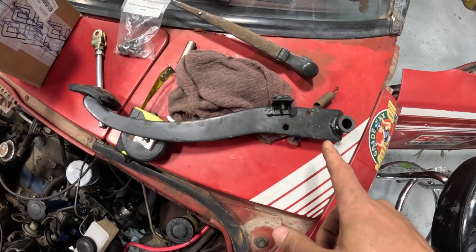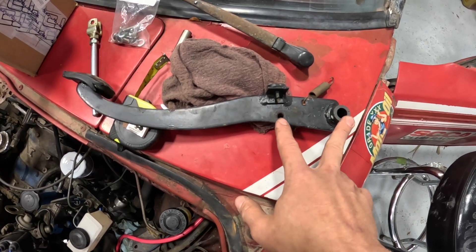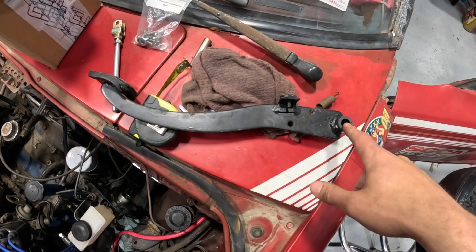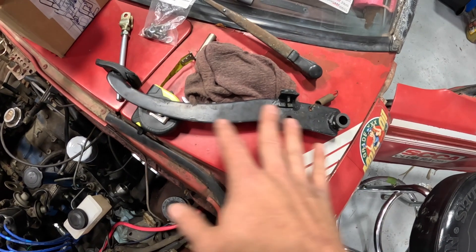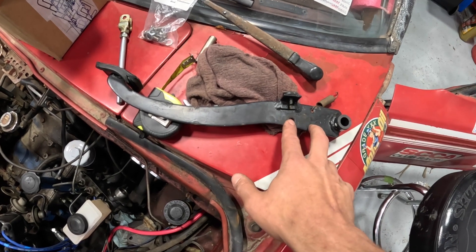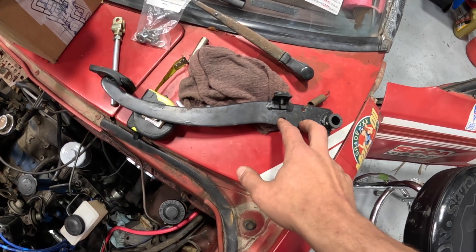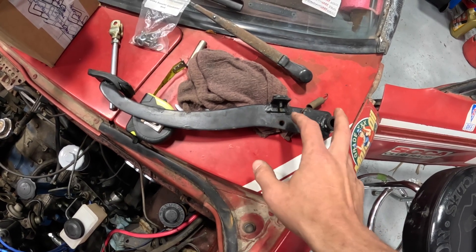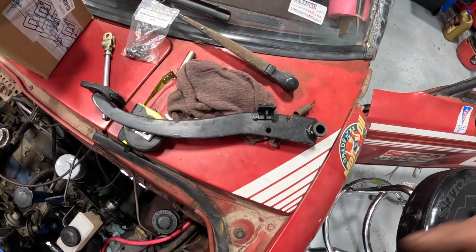I got the brake pedal arm out. If you measure the distance between the pivot and the normal hole down here, it's three inches. And it's about 13 inches from the pivot down to the brake pad where you push with your foot, which comes out to right around that four and a half to one multiplication ratio. So I need to drill a hole about three quarters of an inch up from the original to get closer to that six to seven to one ratio — enough improvement without getting the hole too close to the edge.